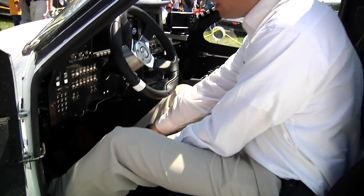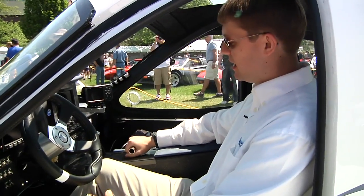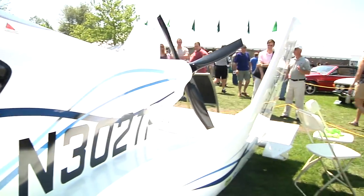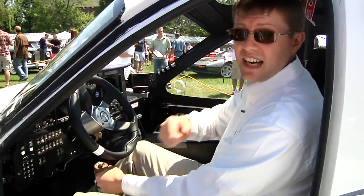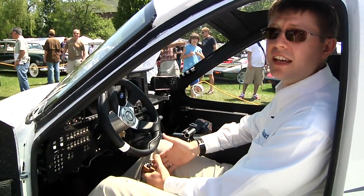When you're flying the aircraft, this is the control stick — it telescopes up into position. I've got my right hand on the throttle here on the center console, left hand on the control stick. When I move this stick I'm moving the control surfaces — there's the elevator moving, and when I move it side to side I'm moving the ailerons out on the wing. That's how I would roll the plane and pitch the plane with the control stick — just like a normal airplane.